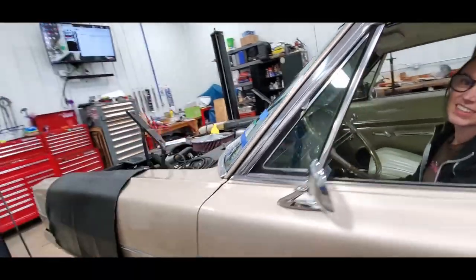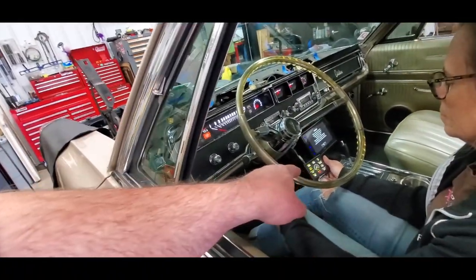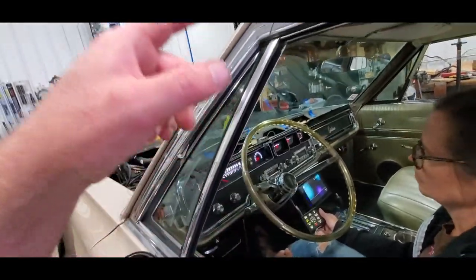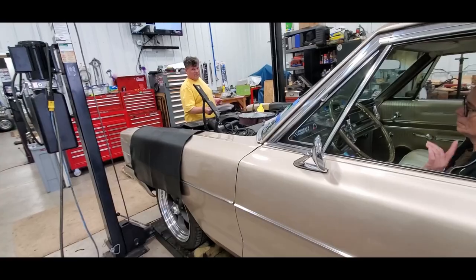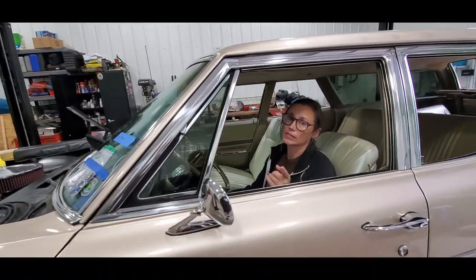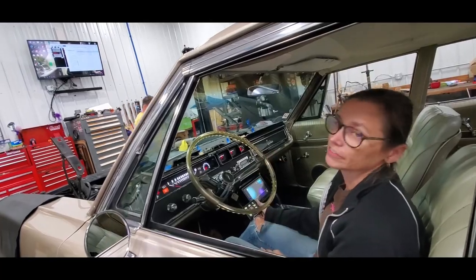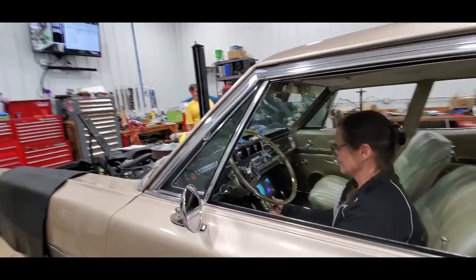Yeah, wish we would have caught that, but she just skyrocketed to 1600 RPM and we watched it happening. Cheryl said, hey, something's funny. And the IAC kept dropping, and then it was 2, and then it was 0. And then the engine went to 1600 RPM and we had to shut it off. So it started at 165 temp wise, and when it jumped to the higher RPMs, it was at 170, 171. We're sitting at 172. Yeah, there's something funky going on. Yeah, that stinks because of the way we shut it off.